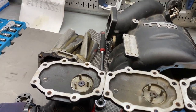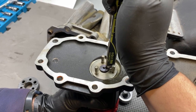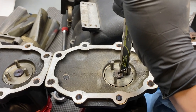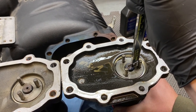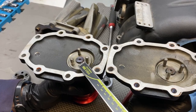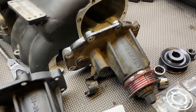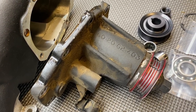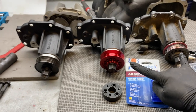The distance between the top of the shaft and the plate with the pins is approximately 2.8 millimeters on my first nose cone, approximately 3.2 millimeters on the second, and approximately 3.2 millimeters on Stevo's. The ones with the beveled shaft seem to be sticking out a little bit more than the one without the bevel. We also notice different numbers stamped on the bottom of each nose cone.